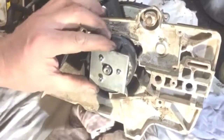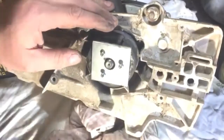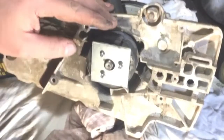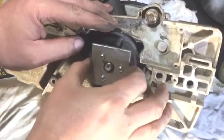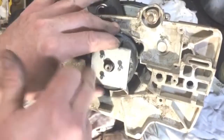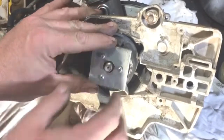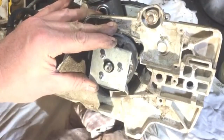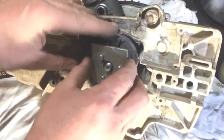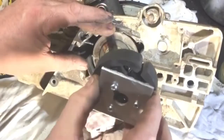That's pulled off nicely - it's off! So that's how I did it. You do need a 2-jaw puller. Mine works fine, but any one will do as long as it's wide enough to get over your washer. I just searched around and found this square washer with a hole right in the middle. The proper tool for this is about £17.50, and I'm not sure what other machines it fits either - so a little homemade tool has done the job.